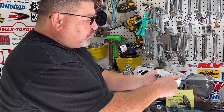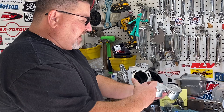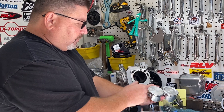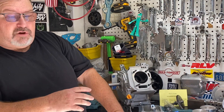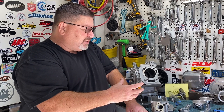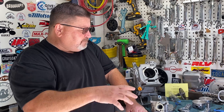This piston will go right into a stock hemi engine, but we want to get that piston up in the bore. So I'm adding 20 thousandths with the piston and 20 thousandths with the connecting rod. That should get me theoretically at 17 thousandths in the hole. What I'm really looking for is 20 thousandths in the hole, but as long as we're not spinning it over 7,000–7,500 RPM — which is going to be tough with this engine because it's going in a heavy Coleman bike with a torque converter — 7,000 really is a fairly good ceiling for this build.